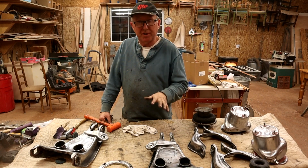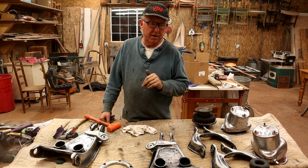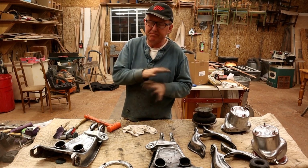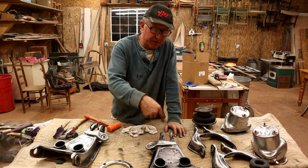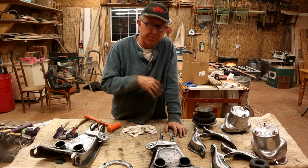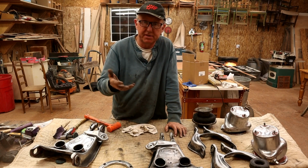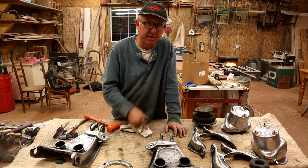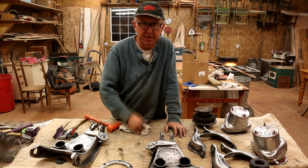let's think, especially for the rust encapsulator, because that stuff is like that miracle paint. If you leave any little bit on the lid of the can or anything, and you put that lid back on, that lid's not coming off again. So with that in mind, when I go to spray the rust encapsulator on these control arms and then the under yoke, I'm using a cheap spray gun. I'm not using my nice spray guns. I've got DeVilbiss, my GTI Pro's a $350, $400 gun, and I'm not putting that stuff through that. And it's just the rust encapsulator anyway. You can actually brush that stuff on.